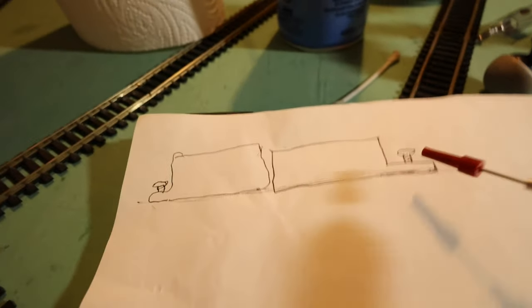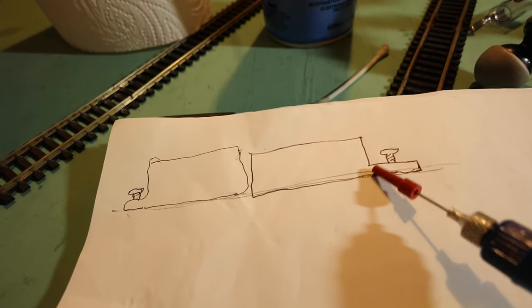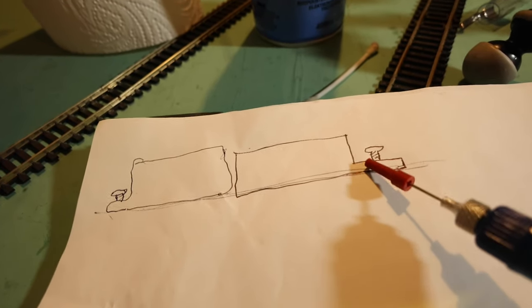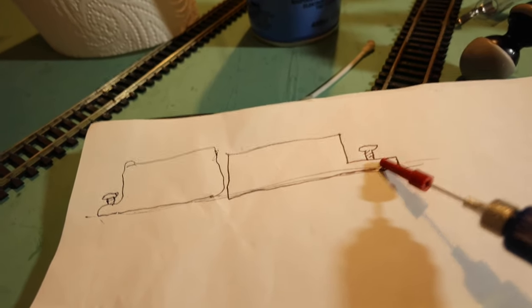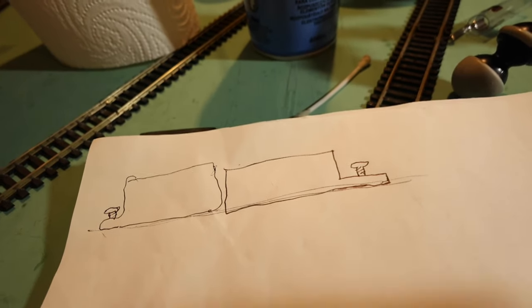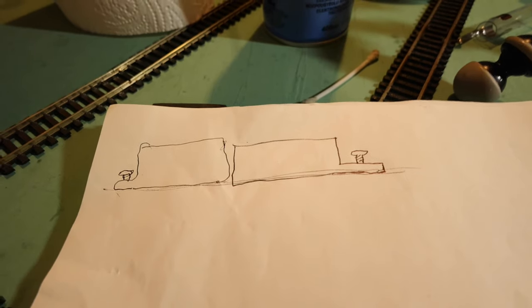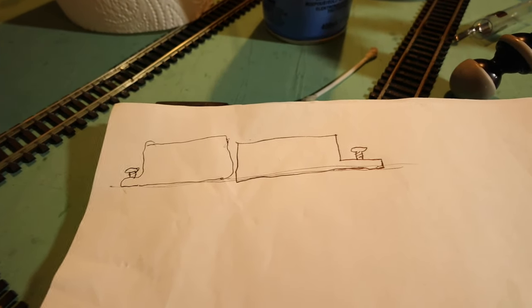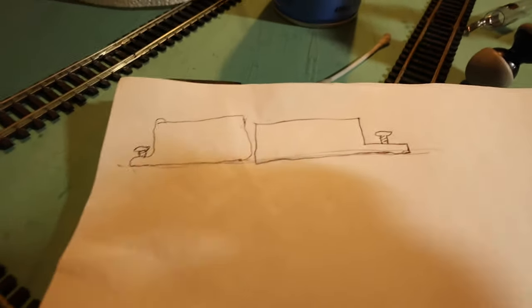When I took this piece off here, which covers the motor, I very, very slightly bent this piece down here, trying not to break it. Gently bend it down until it was down far enough. Now when you did up the screw, it wasn't pushing down too hard on the worm drive. And that's all it was. That piece there, the worm drive cover, was too tight, so tightly pressed down. And you see it here.